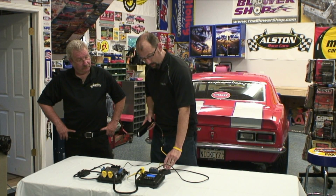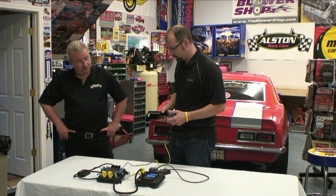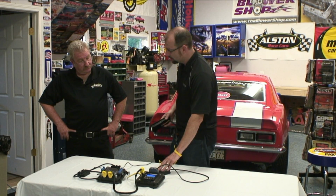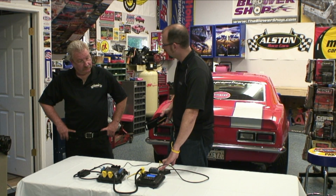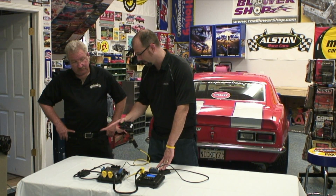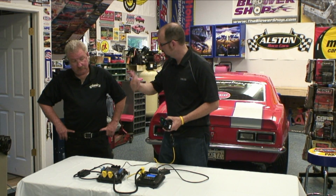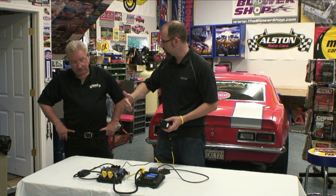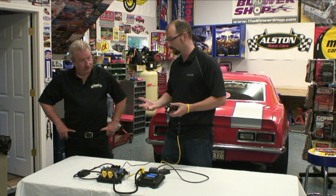It's set up with an input for wide open throttle. So I get in the car, I arm the nitrous system, I hold down my trans brake button, and I hit wide open throttle. When I release it, I've got whatever delay I have dialed in here for the trans brake, and then it progressively stages up: stage 1, progressive, then stage 2 and stage 3. And again, you can dial all that timing in real time in the car.